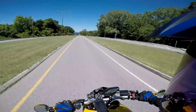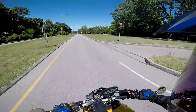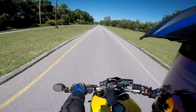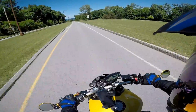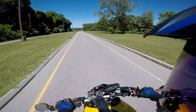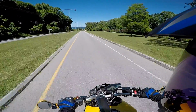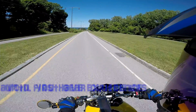And then really, to practice this, you're gonna wanna practice clutching up in, say, second gear, a gear that's not super torquey. And you're just gonna find where your torque range is and pull in the clutch, give it a little more throttle, and then slip the clutch.